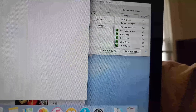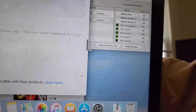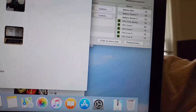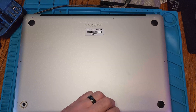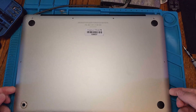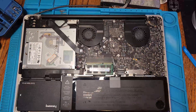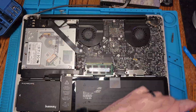After playing around on the computer for a while, I decided to download Macs Fan so I could see how the temperatures were and be able to control the fan speeds. Mac tries to keep it quiet, so fan speeds are typically very low from the factory. I wanted to raise the fan speed, but unfortunately the temperatures were still fairly high only watching YouTube. So we're going to tear it down and replace the thermal paste — which I do with pretty much every electronic I get — and make sure there's no dust clogging the fans or vents. I don't really expect any performance gains; this is more of just maintenance to prolong the life of it.